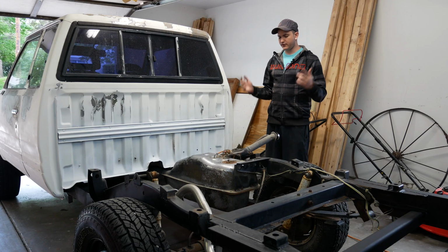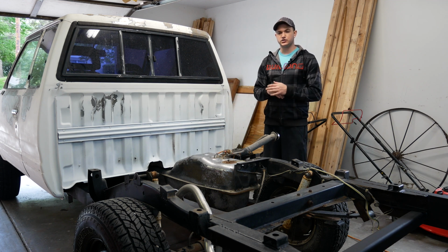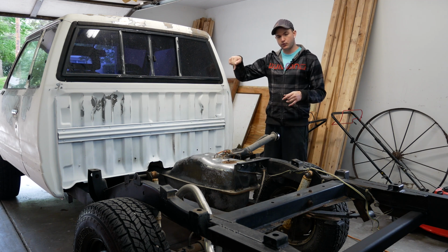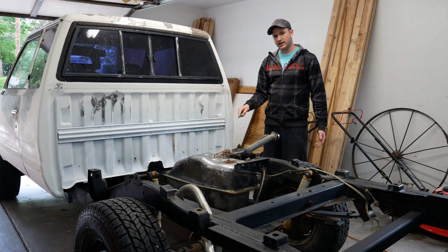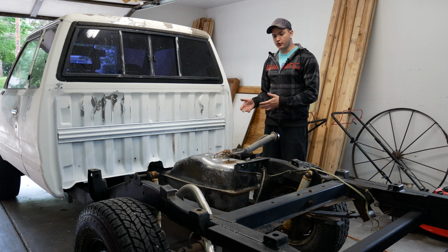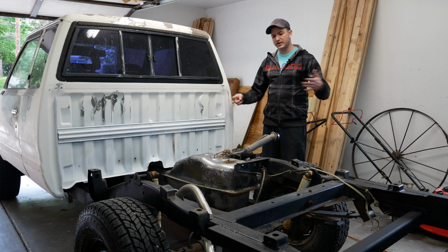And there we go. We have the fuel filter in the truck and in the correct direction. I confirmed things with some of the guys in the Facebook 720 group, and they agreed that the out should be facing outwards towards the fuel pump. The previous one didn't have an arrow on it, but the out was flipped around, facing the wrong direction compared to its orientation now. So I'm going to say that the previous one was in the vehicle the wrong direction, whoever did that, and now this preventative, easy, cheap maintenance has put it in the correct way.